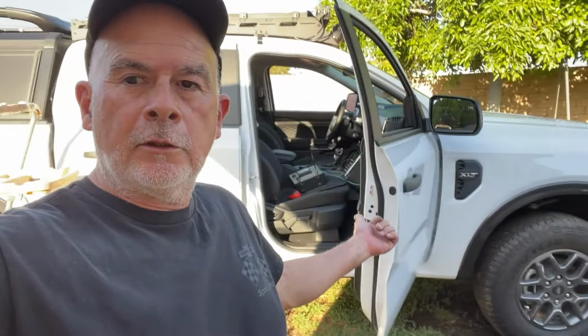Well, I gotta get busy with something. I want this truck ready to go, right? Even temporarily. There's certain things that gotta work. So guys, I got my SWR meter hooked up and I'm checking the SWR, and apparently the SWR is higher on channel 1 and lower on channel 40, which means my antenna is too short. I hope not, because I cut that antenna.